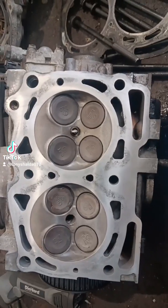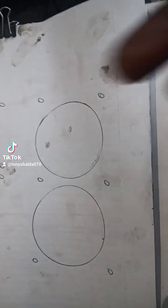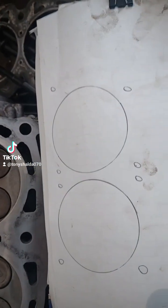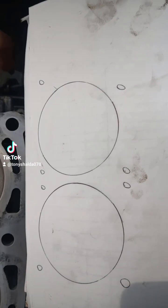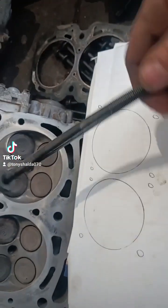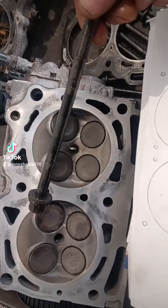For those of you who don't think there's enough bolts, let's get that out of the way because that's the most ridiculous. I drew you a picture. This is what we got right here — six bolts, all nice and uniform. This is what you're voting for: four bolts per cylinder. Which one looks stronger to you? I doubt it's the one with two deep threaded holes in the block right next to each other. And if you don't think the bolt's strong enough, this is a massive bolt — bigger than most people would expect to have in there. So that's out.